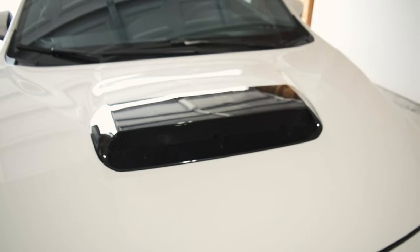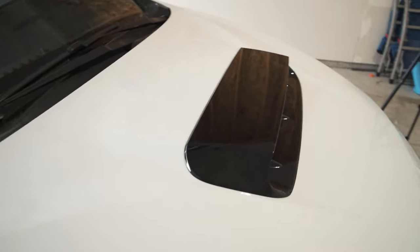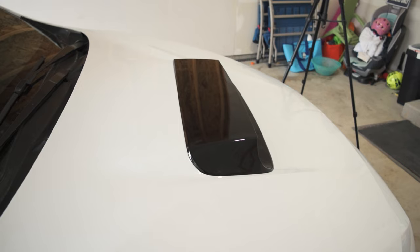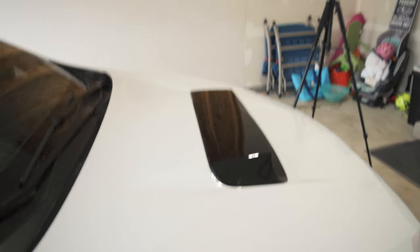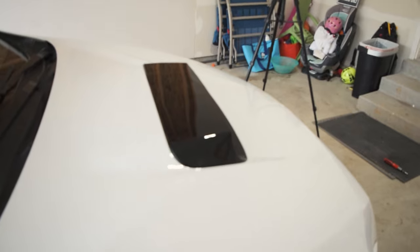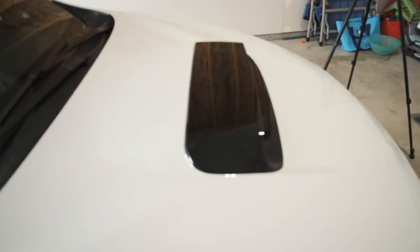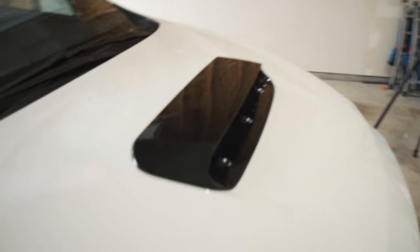Now, the purpose of this is for the plastic to sit on the foam, and the foam to be the intermediary between the plastic and the metal. Right now, the plastic is sitting right on the metal, which is what's causing a lot of the breaks. This is a temporary solution. If it works, I'll see if I can get actual weather stripping to put on the hood itself and then cover it up. Right now, this is just a real quick proof of concept.